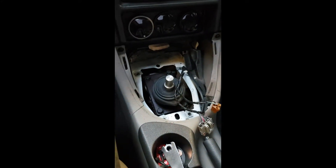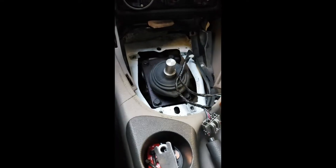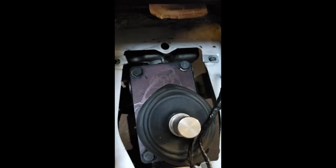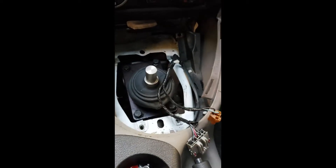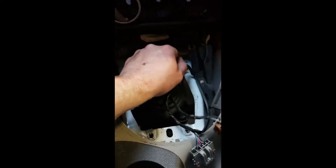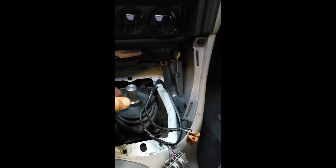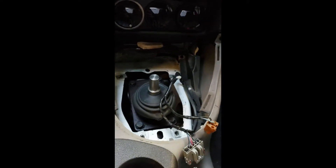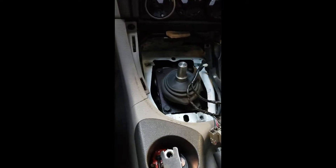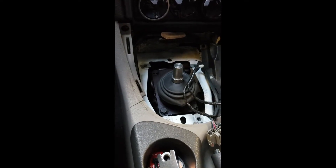Here's a little camera trick — as I said, it's just those four 8 millimeters and it's gone. That's the MGW shift plate; you could remove that but you don't have to. What I like to do is put this in third gear — it gives me just a little bit more room so when the transmission comes down I can go back a little bit further. Now everything up here is complete; we're going to lift the vehicle back up and do the bell housing bolts.